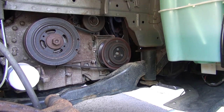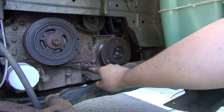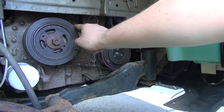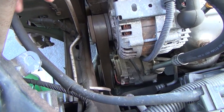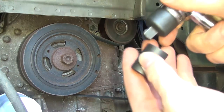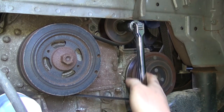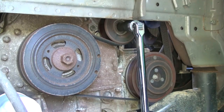I'm going to post a photo on my website, omstricken06.com, in the blog section of the exact route that this belt takes on the engine. So let's take a quick look since we're already here. As I mentioned, this is your harmonic balancer — this is where the crankshaft is — so the belt loops around this way, continues down to the AC pump, and goes up. In reverse order: it comes down below the tensioner pulley, up to the alternator, down from the alternator to the water pump. I'm going to put my socket onto my breaker bar and apply clockwise pressure, which should release the tension on the belt.